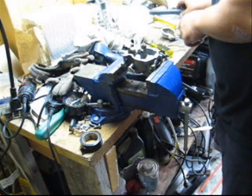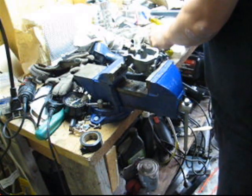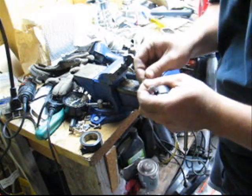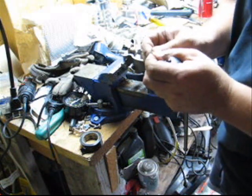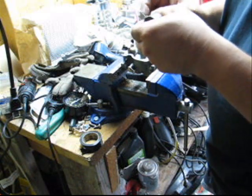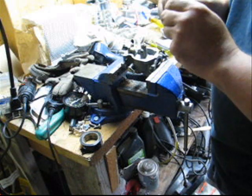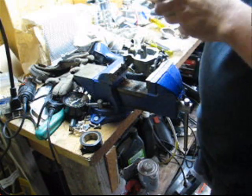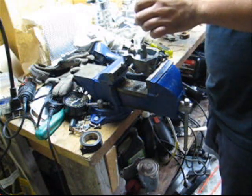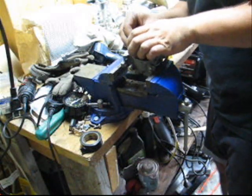If you ever forget how you took something apart or put it together, it's always good to take pictures beforehand or as you're disassembling a carb, so you remember what's what. So we'll put our clip here, probably out of the frame, on our needle. These things can get quite dinky. See, I've put it on the wrong way. We're going to put the clip on the float. We're going to stick the retaining pin back in, like so.